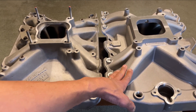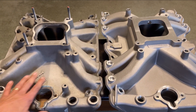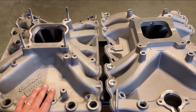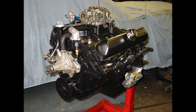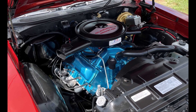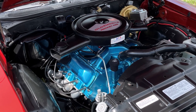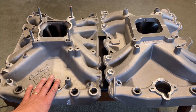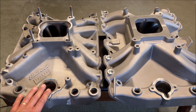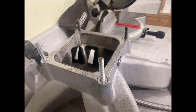Oversimplifying, some people say a single-plane doesn't give you as good low-RPM performance. The step above an Edelbrock Performer or Performer RPM dual-plane intake — and here's a picture of the Edelbrock Big Block Performer intake — is now a dual-plane high-rise air gap intake, which both Speedmaster and Edelbrock make. The step above that as a single-plane was the Torquer, a lower-rise single-plane. And then there's the Victor intake, which is mammoth — your max all-out effort intake.